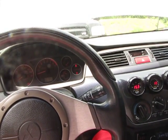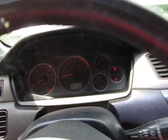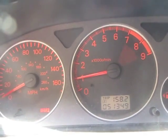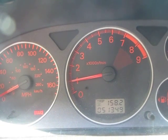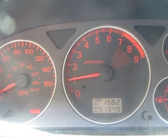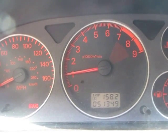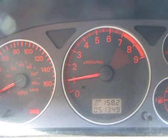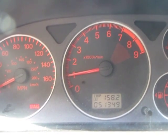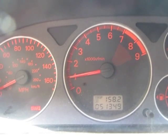I'm going to rev the car up a little bit — watch how it drops back. See, it never drops below 900 RPM. If your car ever dips below normal when you rev up like that, that means your idle air controller settings are not correct, or your base idle set screw is not calibrated properly with your idle air controller settings, and they will work against each other. The idle air controller will malfunction and will not save your RPMs as they dip.